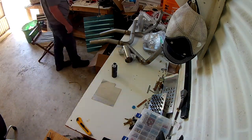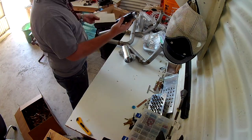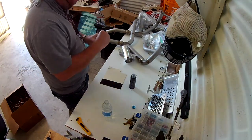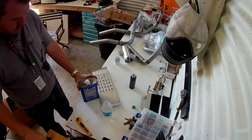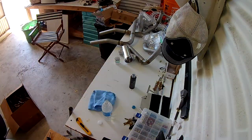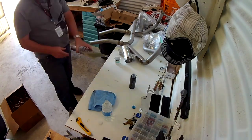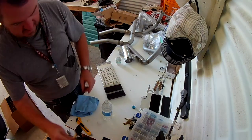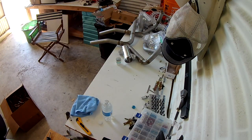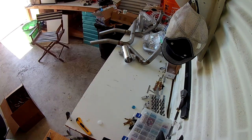A couple of things we're going to work on today. One, we're going to do a little paint experiment. That little black ball of paint there is called Black 2.0. Black 2.0 is the darkest pigmented black you can buy — actually, there's also Black 3.0. We're doing test samples on primed and non-primed metal, with the idea of using this paint on top of the glare shield because it's so black you won't get any reflection. We're trying it pure and watered down to see which has the best coverage, no brush marks, and good pigmentation.